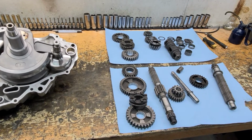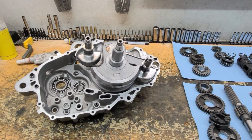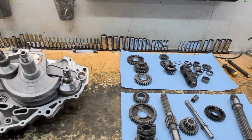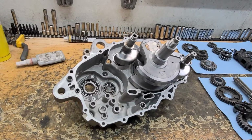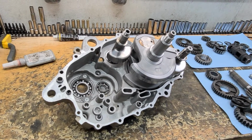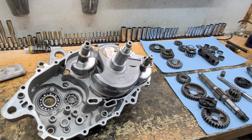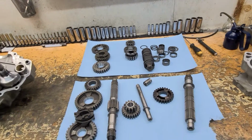One last thing on that: if you go to do an upgrade or put a crank in an engine that didn't fail, and you pull apart the engine and there is no gritty debris or sludge in the bottom of the engine, normally you can reuse the engine bearings. Flush them out, check them, make sure they're smooth. On engines over 2006, like anything over 8 years, I normally put a new oil pump in, because I give them about a 10-year lifespan of normal use until we see enough wear in them to want to replace them. But if it's already 6, 7, 8 years old, you should probably go ahead and do that, because most likely nobody's going to change it anytime soon after that.